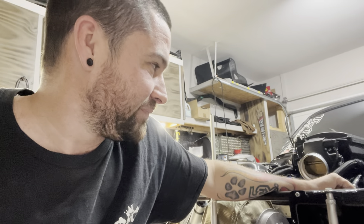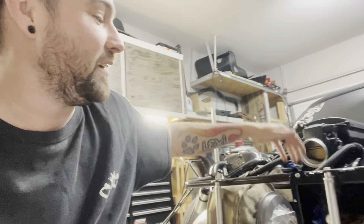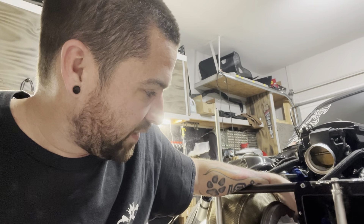When John made all that boost — I had to ask John why he was smiling and laughing so much, because I didn't know what was going on. I said, is that good? And we just made really good power. He was like, yeah, that's really good, it pulled out really fast. The car looks good. So the nut fell off, it made a lot of boost, and it blew the housing off. When it blew the housing off, the housing went crooked sideways and came in contact and had a fight with the compressor wheel. Now the compressor wheel and the housing have a couple of bruises and scrapes from their altercation.